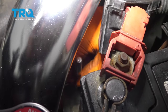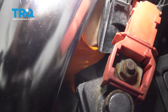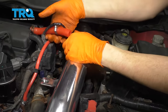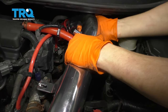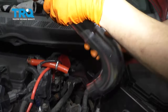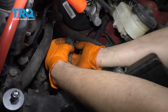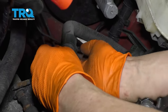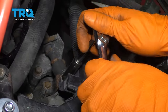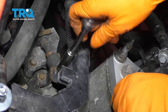There will be another one of these clamps that you have to loosen. Now we can grab this hose, disconnect it, lift up on the intake on both ends, and fish it right out. Now grab this wiring harness — there's a little clip on the back here. Pry it out and then pull up on this. That'll unsecure the harness from the retainer, and with a 10 millimeter, remove this bolt so we can pull this harness up because we need access to everything underneath.